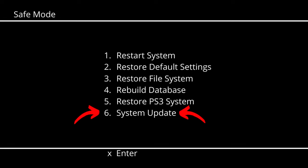You're going to want to select the bottom option, which is to check to see if it is updated. If your PS3 is connected to the internet, it should be able to check and update automatically. If not, you're going to want to go onto the PlayStation website, get the update, save it to a flash drive, and then put it in the PS3 and choose that option, and it will update from the flash drive.